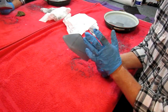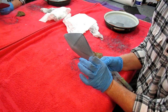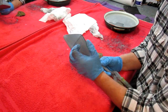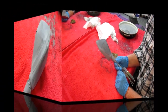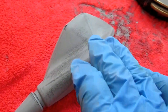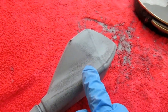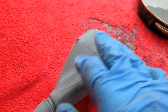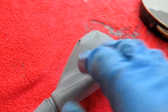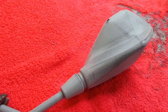You're never going to regret spending the extra time to put that last coat on, or an extra sanding. In the end, when you go to ride the motorcycle and your friends are ogling it, you'll always be happy that you put that extra work in. Another little tip: when you're putting the last coat of primer on — when you know it's the last coat and you're not going to sand it, just paint over it — it's good to use a brand new can of paint. When the can is full of aerosol, it sprays a lot nicer than when you get down to the bottom third and it's spitting and missing. You'll get that nice, smooth, thin coat, and then that'll go up by the heating vent to dry 45 minutes to an hour and we'll be ready to paint black.